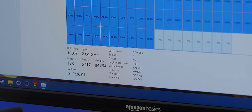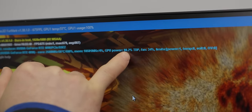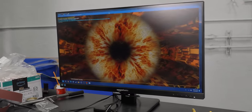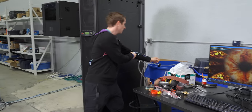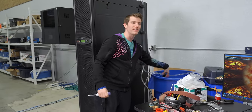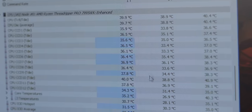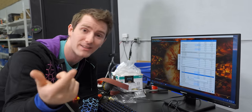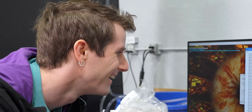Good morning. It's been about 14 hours and things are looking real good. CPU usage is still 100% from Prime95. Furmark is doing this weird thing where it's hitching sometimes, but it's still using 93 to 99% power. We've reached a maximum of 56 degrees, which means with one system on here, we are still looking at coolant temperatures that are barely lukewarm to the touch. That is fantastic. CPU temperatures — wow — 40 degrees. These Threadripper chips kick out a lot of power, but they're so big that the size of the die isn't as much of a heat transfer bottleneck. What kind of power is it drawing? 350 watts!